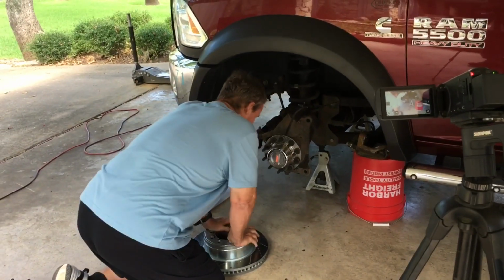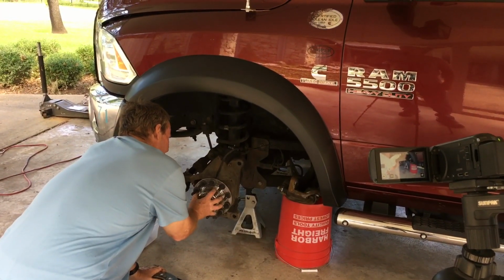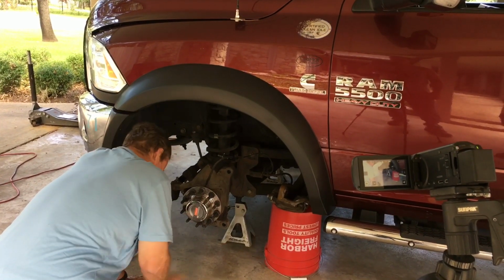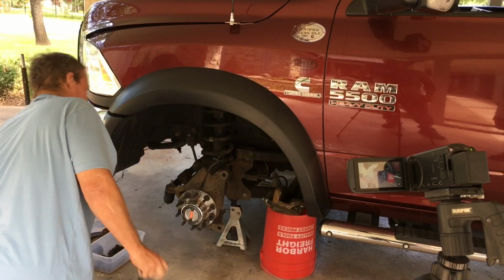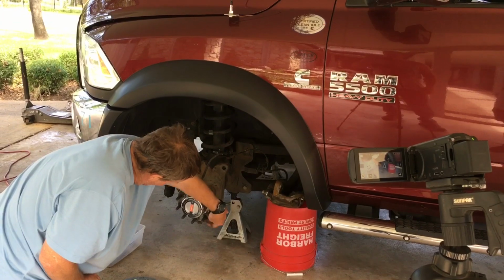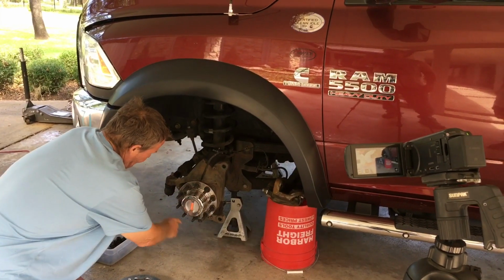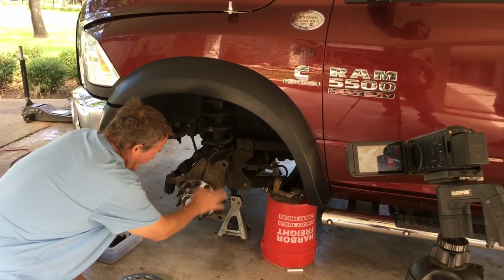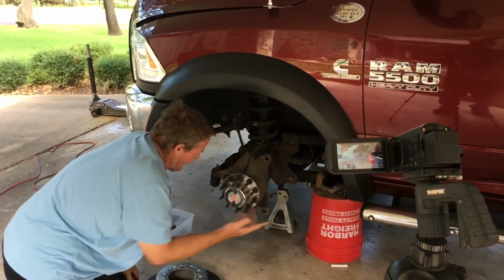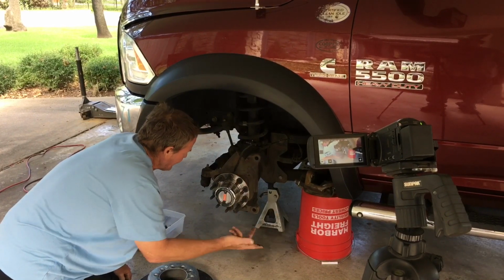So this is what gets hot. And if this is in direct contact with the hub all the time, the rotor heats up the hub and the bearings get hot, and of course that's why they wear out faster. So if you use some spacers like Indy and NASCAR used to do, and some different materials, you cut down the surface area by about 1/5. The contact is about 1/5. So right there, the heat transfers about 1/5 the speed, so you have all that time of cooling off.